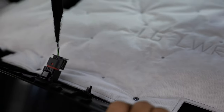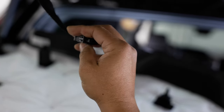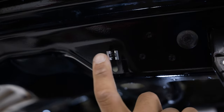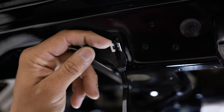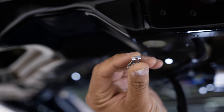Once you pop this panel off, you have your plug — it has a safety connector on it. That little gray portion you're going to slide the security lock over, then press that security lock down and that'll release your connector. Now we can set this aside. Once you pull your panel off, if you're lucky all your clips will have gone with the panel. If not, you'll have a bunch of clips left on your liftgate — you'll have to pull these off with your panel tool and reattach these to the plastic. That's what the small needle nose pliers are for.